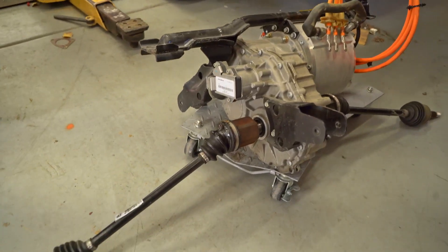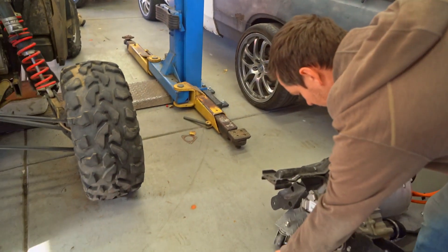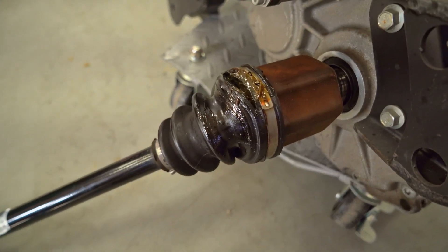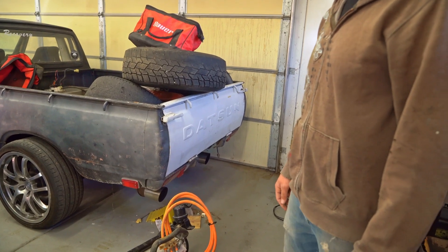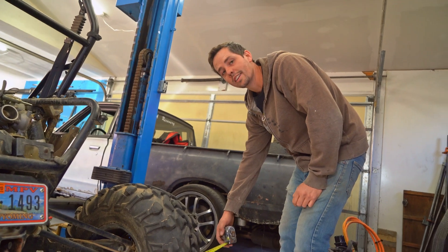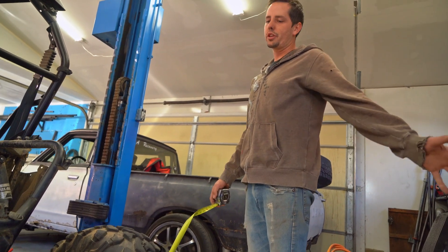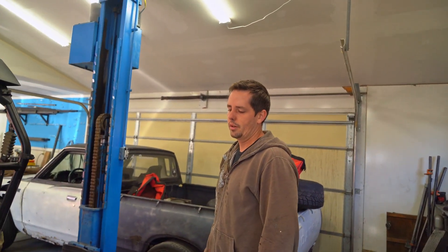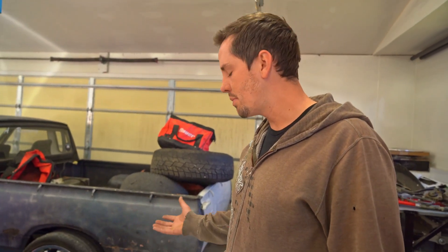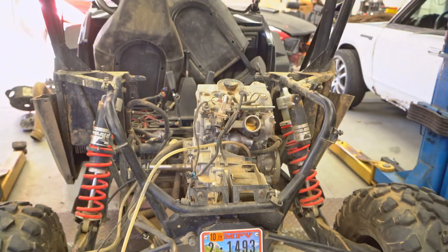The axles are the original Coda axles — we spent $200 on those. Measuring the width, it's about 67 inches wide, making it about seven inches wider than the Razor currently is. That's good and bad — it means we can make the suspension much longer travel if we use these axles, or we can cut them down to keep the original width. From a size perspective though, this motor is not larger than the original motor, so that's a good place to start.